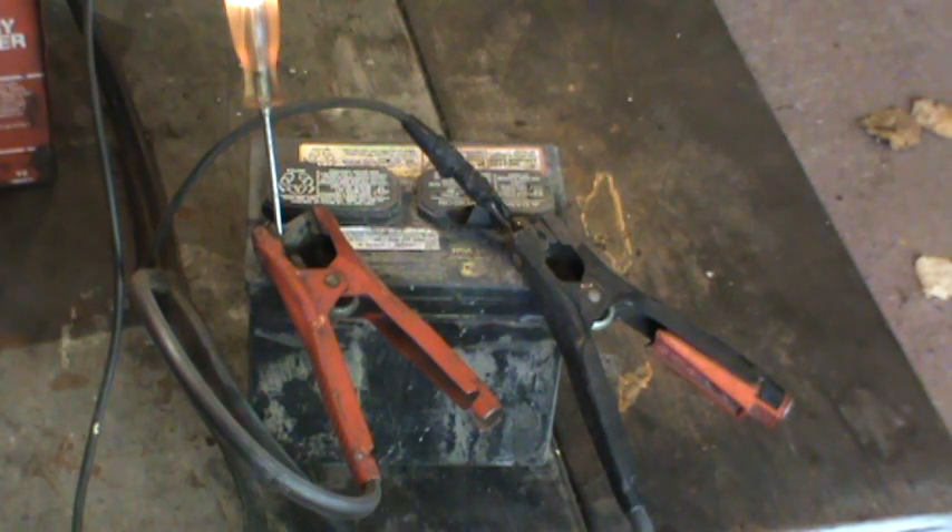If you put a test light across the battery terminals, and let it sit with that light on there, it's kind of tricking the battery charger into recognizing there's something on the other end that it's trying to charge. You can leave that on there. I also use it to test how the battery's taking a charge — come back 20 minutes later and turn the battery charger off. If you see that it's holding a little bit and the light's dim, and it's starting to take a charge, then you know if you leave it there, eventually it will take a charge. The slower you charge a battery, the better — heat destroys batteries.